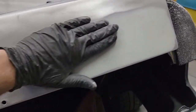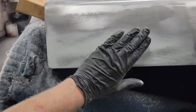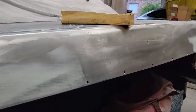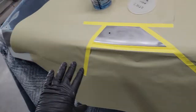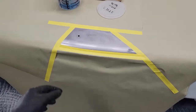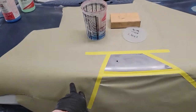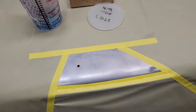I just need to decide — probably prime it out, but I may go ahead and glaze it. When we get this side done, if it needs glaze I'll have the glaze out anyway and I'll just put some over there. I'm down to this area here — I've got glaze on some spots down in here, and I found a couple small dents that I didn't see before in the ends. There's one here and one right in here. I'll let all that harden and block it later.